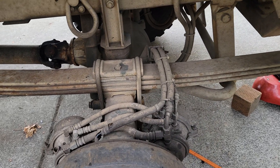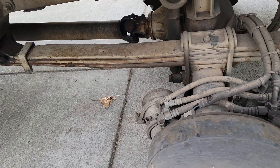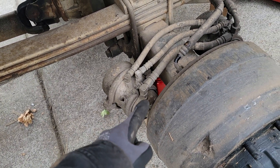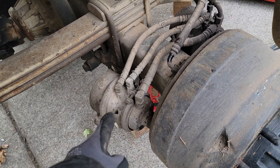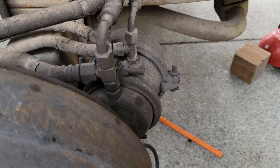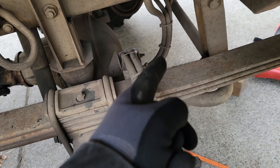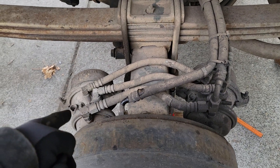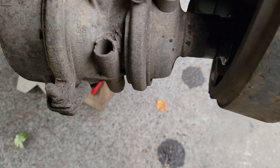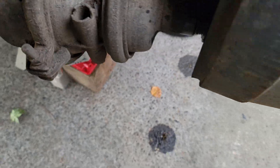For the rears I'm going to do one side at a time so I can mirror the hose connections off of the other side. These are looking pretty shoddy. The reason I bought new brake chambers is because I didn't want to deal with all the snapped off fittings, and I actually got a really good deal - only a couple hundred bucks each. I'm going to take the hose block off, snip all the tie wraps, start labeling things, and hopefully these brake chambers come off friendly. I've been hitting them all week with PB Blaster, so fingers crossed.